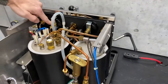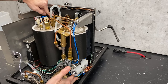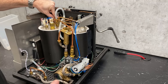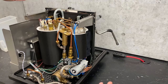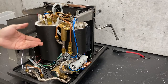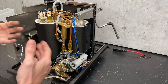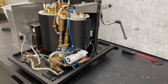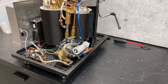This gauge is only ever going to register the pressure coming through your pump. Meaning if it's on the plumb line and you've got two bars coming from your water inlet, that's what it'll read. Or if you have it running at 10 bars when you're pulling a shot, that's what it'll read. When the system is shut down on reservoir, it's not uncommon to have it reading zero because you have no pressure in the system. On a plumb line, you've always got that line pressure in the machine.